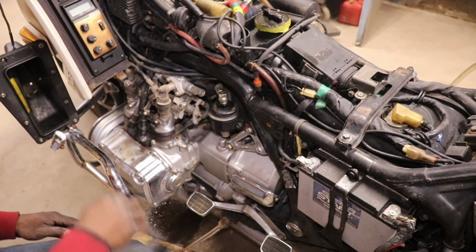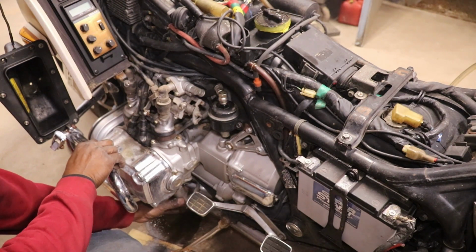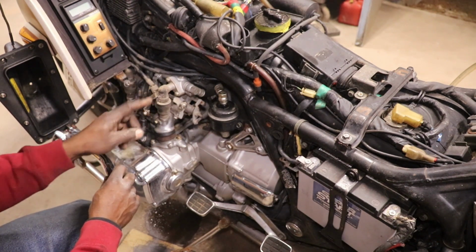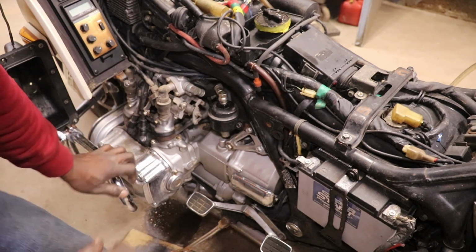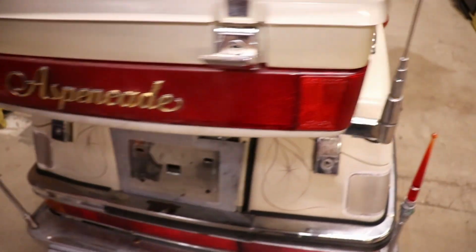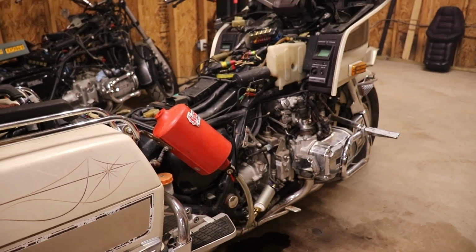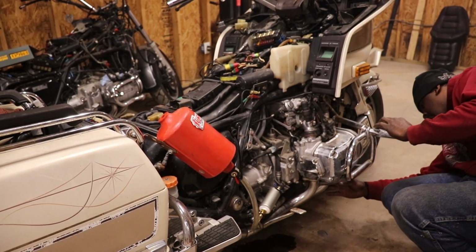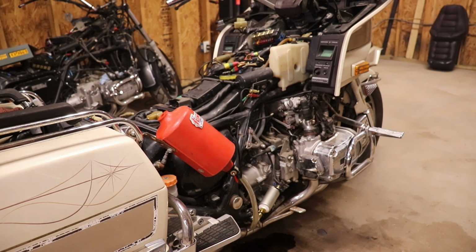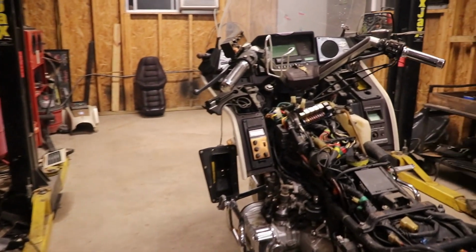Injector. Let's do the pipe test. That one's cold. That one's cold. So it's not doing anything on these two cylinders over here. It's only running on two cylinders. Could be these injectors sticking. Let me go to the other side. Hopefully, we don't have a wiring problem going to the injectors. Definitely that one. So them two cylinders over there are dead. And I'm believing it could just be the injector sticking.